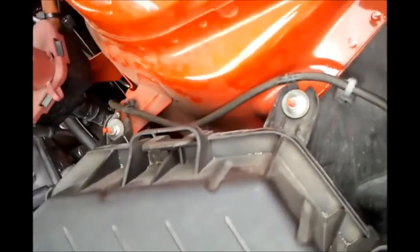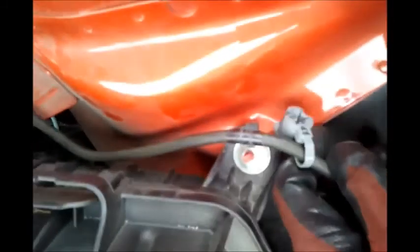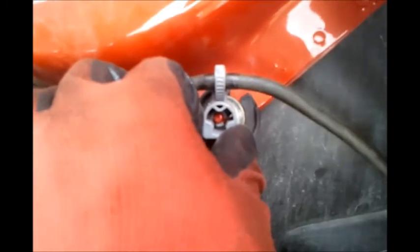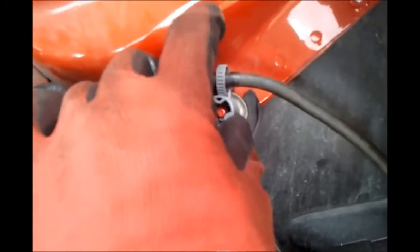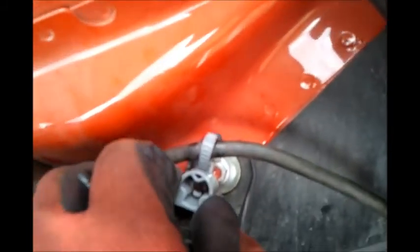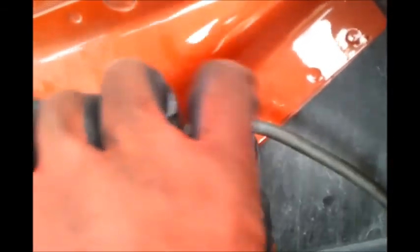Over here, where the air box is, you've got a couple of 10mm bolts holding the air box in place. There's a little wire organizer clip that sits on top of the nut. You can't get it off by rotating because the cable is connected. To get it off, you've got to use a knife, a pick, or a precision screwdriver. Push the locking tab and pry it away from the ribbed piece of plastic, and you should be able to pull the plastic ribbing up, freeing the cable. Once the cable is off, you can rotate the nut to remove it.